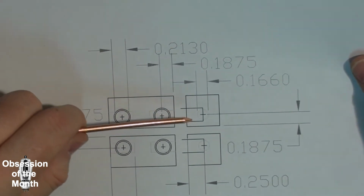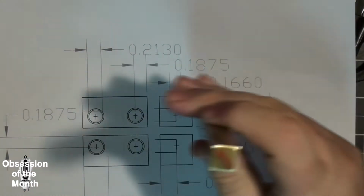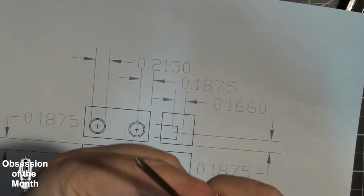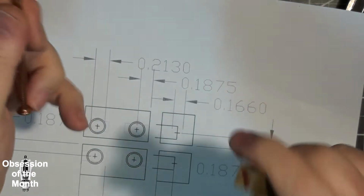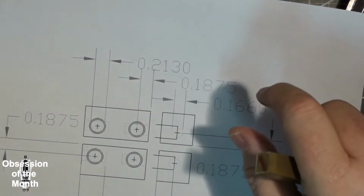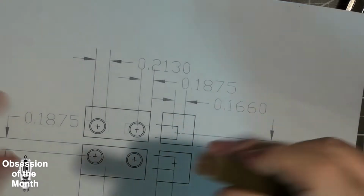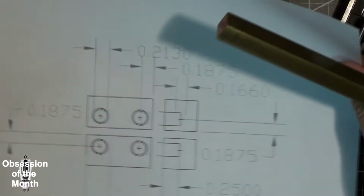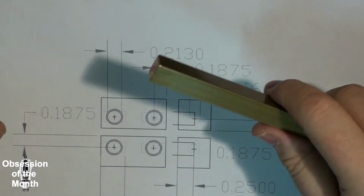The electrodes are offset by approximately 3/16 of an inch from the edge of here so that I can put them close together. They'll be about like that. And if needed, of course, I can just bend the copper nails to get them closer. And there's some unfinished space in here that if I want to mount this to something to make it easier to do certain types of spot welding, then I'll have a place to work.